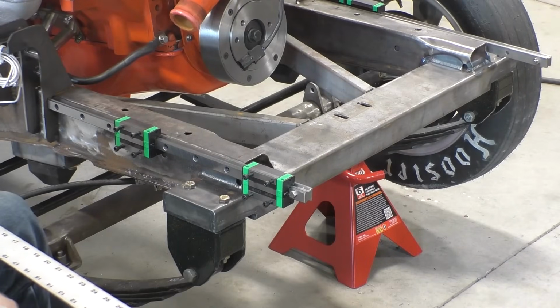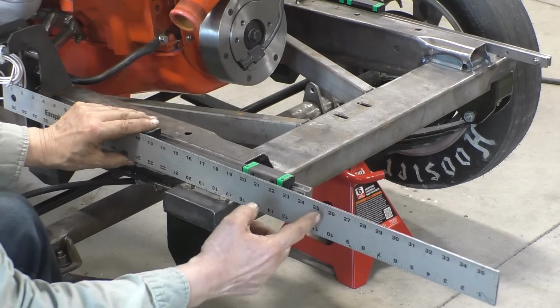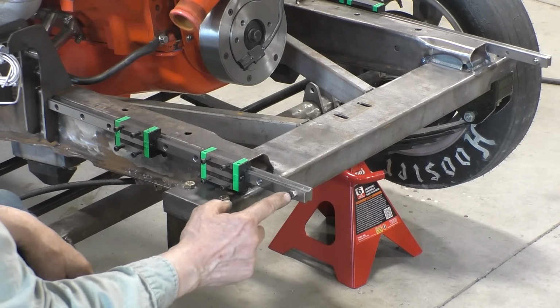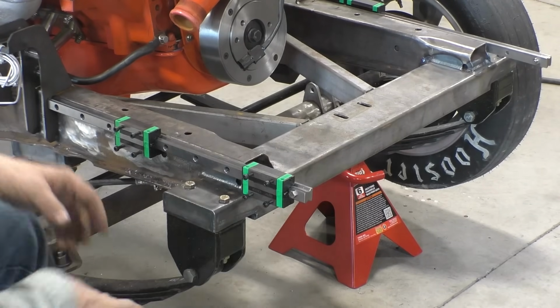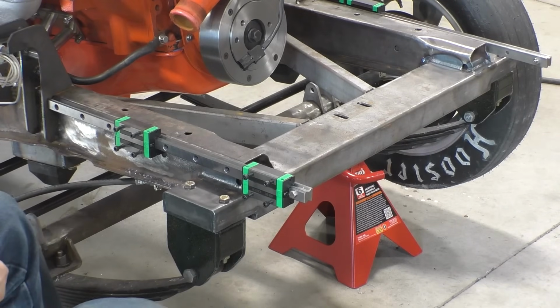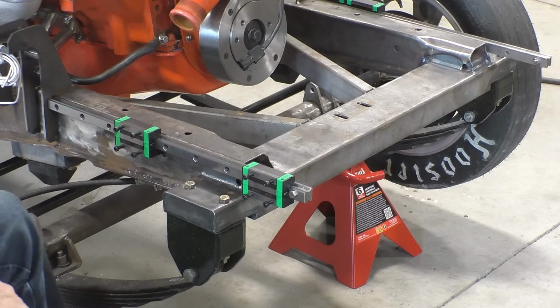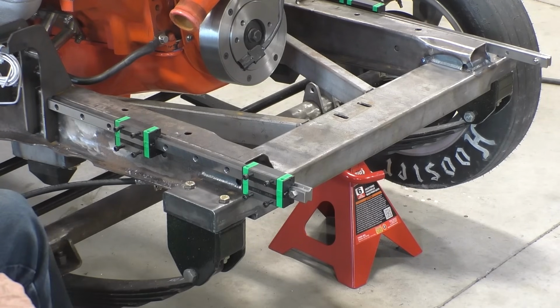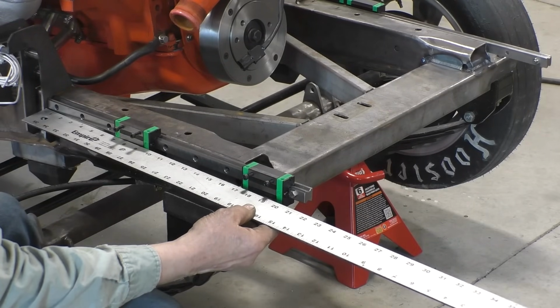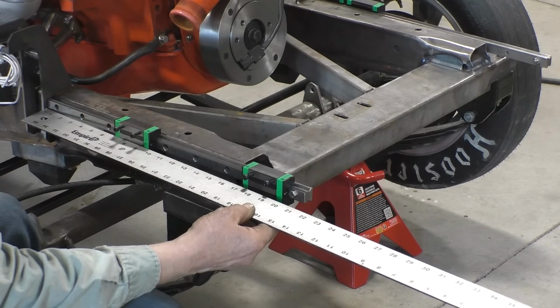The next piece of the puzzle is the plate that's going to go on here that we'll mount our hinge on. And what we have to do is determine the length. Now I've put a 1/4-inch bolt through the rail here as a stop for the block. So that's as far out as the block is going to go. And the hood moves forward 6 1/8 inches, limited by the Howard bearings on the top when it hits the brace on the inside of the hood. So we have to be able to travel back at least 6 1/8 inches. But I don't want to limit the travel back by this. I want the travel back limited by the hood. So I'm going to make it 6 1/2.